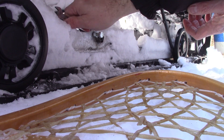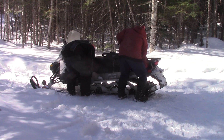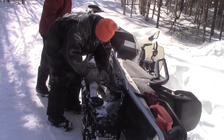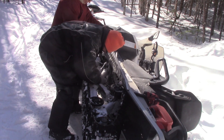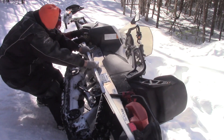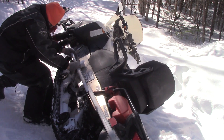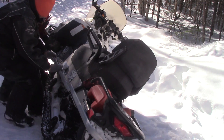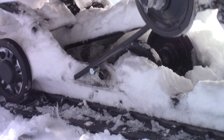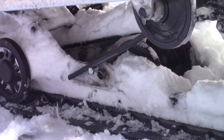Then I fix the bolt in place with two nuts across the frame. We need to put the snowmobile on its side to put the spring back in place — there's a lot of tension on this spring. But now the snowmobile has to come back on its track. Here is our quick repair. Now I'm able to go for a small ride again.